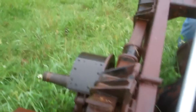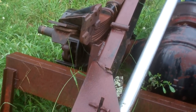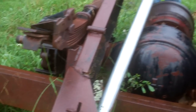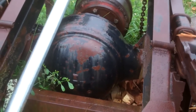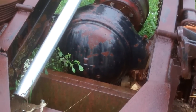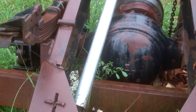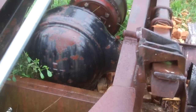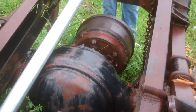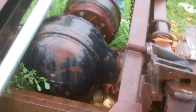This left axle is not blocked off. If I block it off, it makes the other side turn twice as fast with half the amount of torque. So what I've done is gone into the differential here and welded the spider gears together to lock it, which means if I had an axle out on the other side, both of them would be turning at the same RPM. This particular truck differential is geared at 6.5 to 1.